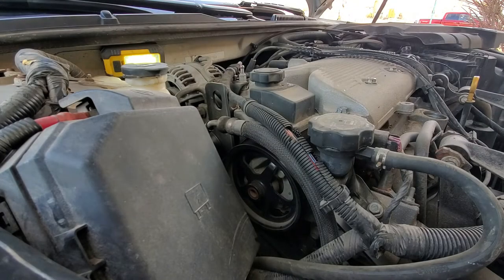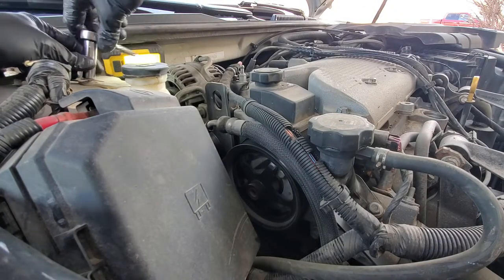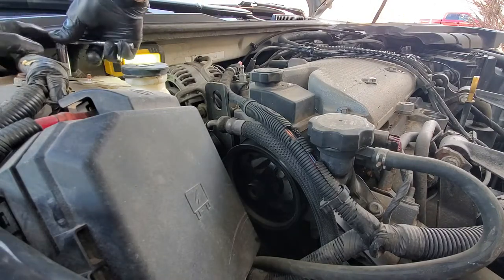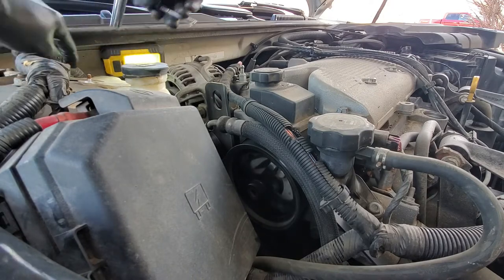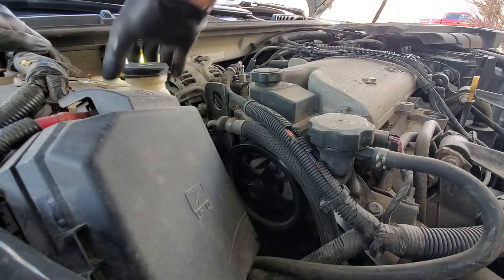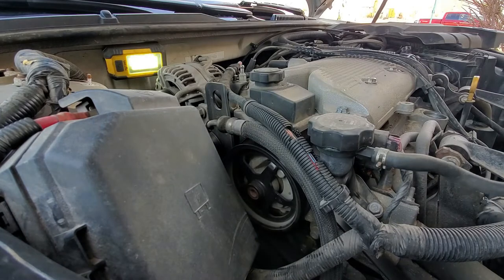All right, guys, let's get started. So the first thing we're gonna do is take these nuts off for the overflow reservoir. 10 millimeter socket. Like always, I will put the sizes in the description below, and any other tools I end up using. Get those off. This just pulls up. And we're just going to set it off to the side here.